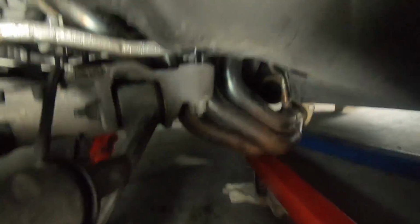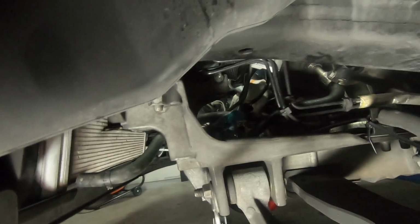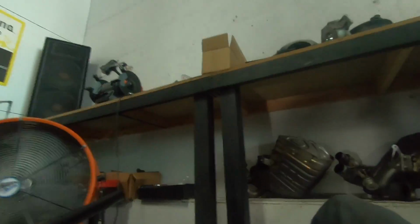Okay, we got it. The cradle is lowered on the bolts, with just a couple threads caught on the nut to hold it in place. The engine is supported with the hoist, so we have some clearance there with the pan. We're gonna try and snake it out. All right, she's out. There's the windage tray. We're under the car. Slipped it out. Oh, we gotta crawl out over here.